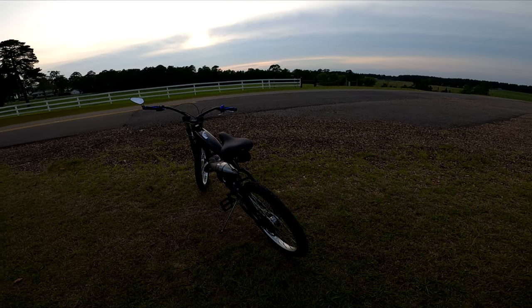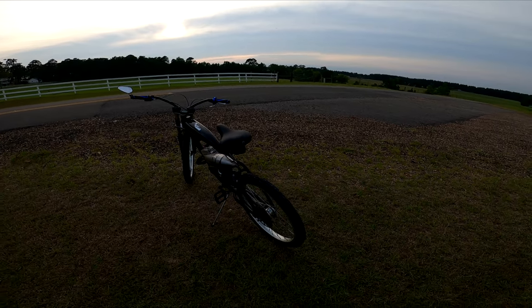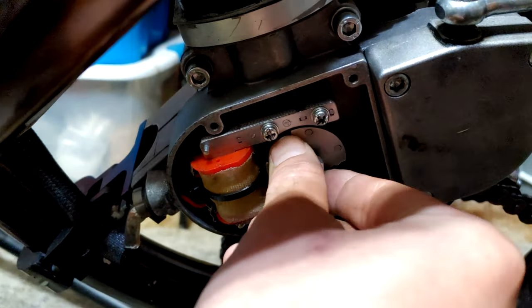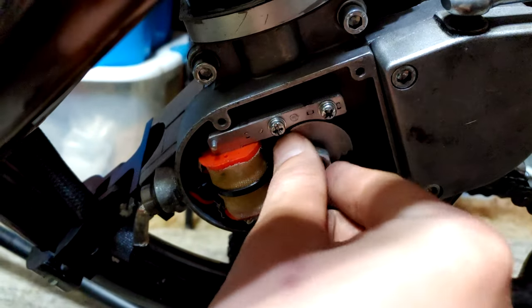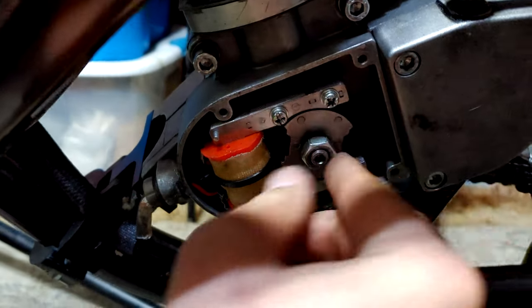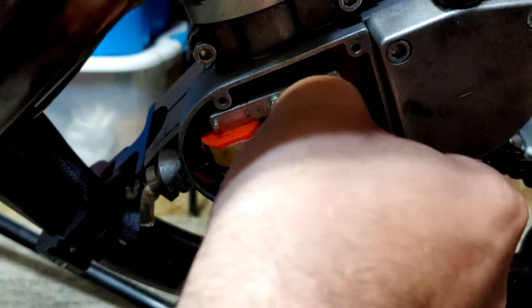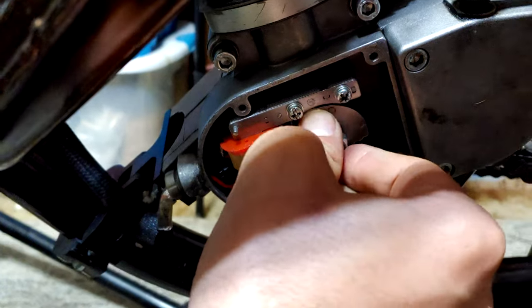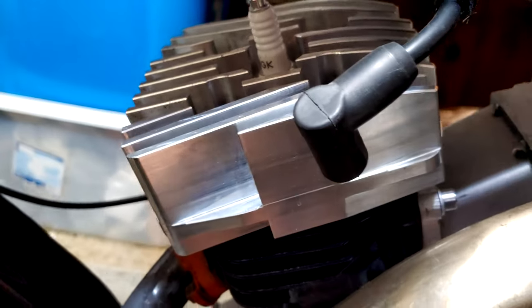It's still removable, but it's like 3 times stronger. The bike actually felt good and ran pretty smooth, but it was lacking in power and would never touch the pipe. After returning home and checking the motor, I noticed that the compression was all but non-existent. I could pretty much turn over the motor with 2 fingers on the magnet side. And that's a big red flag.